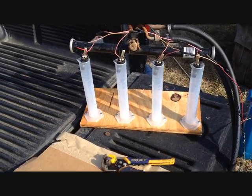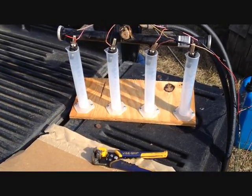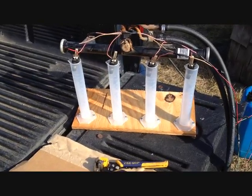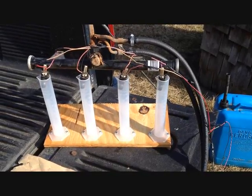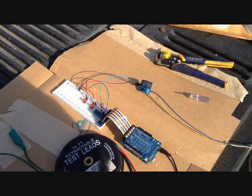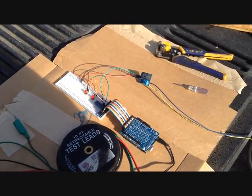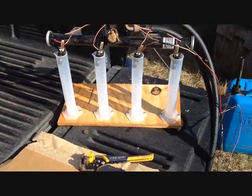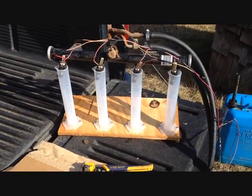I'm testing these — they're only 25-pound, non-modified, non-decapped injectors. I did an online calculator real quick using the Witch Hunter performance calculator and found out that to get about 50 cc's of flow from these fuel injectors, you have to have them on for about 10 seconds. The good thing about the Arduino board is I can program it to be 10 seconds on the nose to the millisecond, so there's no human error in timing. That way I can get very precise flow readings, which is the first test we're going to do.